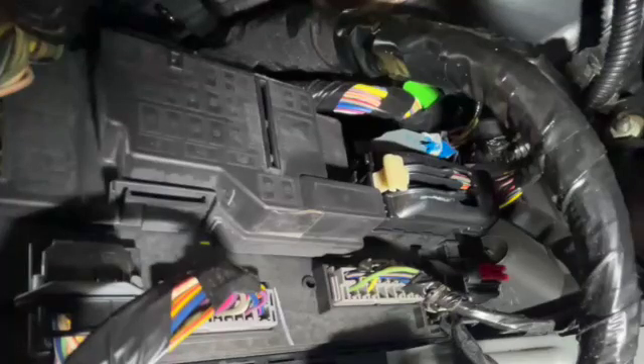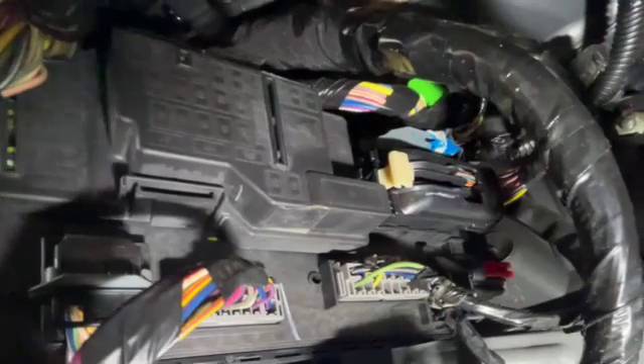The biggest problem is room — it's up under the dash, kind of by your left foot on the left wall of the dash area. Here's the dilemma I'm having on this car. It's a 2010 Lincoln MKS, 3.7 liter base model, all-wheel drive. I put a professional scanner on it, and it said I'm having communication issues and codes regarding the body control module — the BCM is giving codes saying the module is bad.